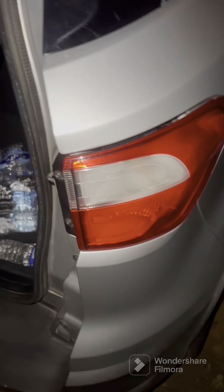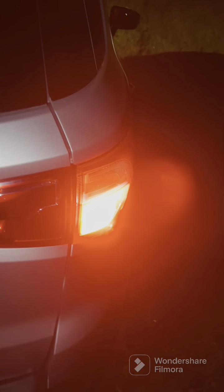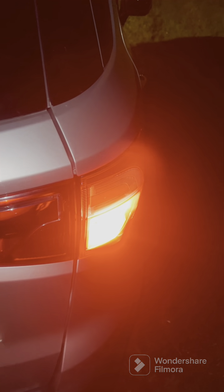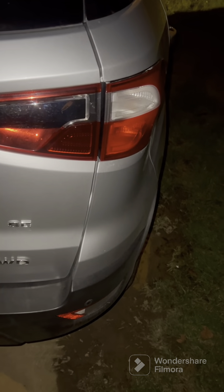Okay, I'm gonna get in the vehicle and hit the brake pedal. The telltale sign that the bulb was bad — you can see it's on now. See, now you have a brake light; we didn't have a brake light before, that bulb was out. The yellow one is the turn signal up top. The telltale sign that the brake light was blown is that the right turn signal starts flashing really fast. When the turn signal flashes really fast like that, nine out of ten times it's going to be the bulb burned out. That's how you change a bulb on a 2020 Ford EcoSport — take care.